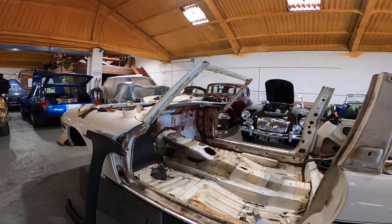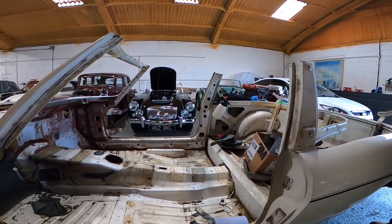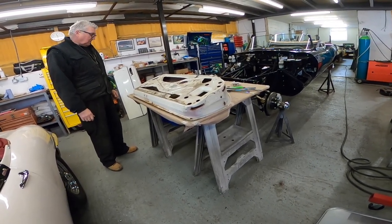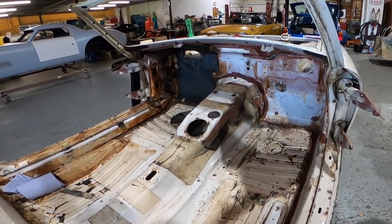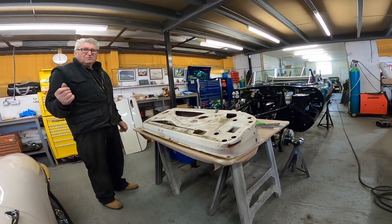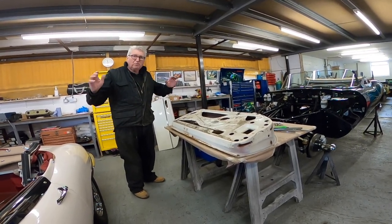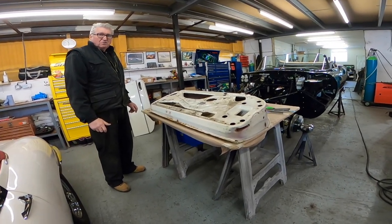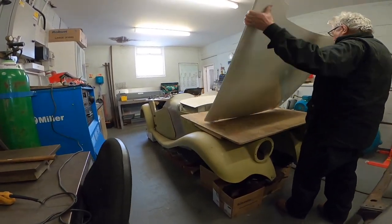Door skins are not normally that expensive. When I fit the wings I need the bonnet and boot on the car to get my distances right. The bonnet's okay — thank God we've found a bit. I've seen a hell of a lot worse. I think the car's a good car, solid-wise. The wings might have had rust under them because of how they've been fitted. When we fit them, we fit them properly — we make sure preparation goes in before the new wing goes on, rather than just bunging the wings on. This has got to be a forever job really.